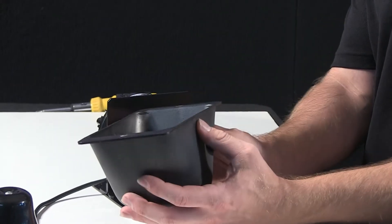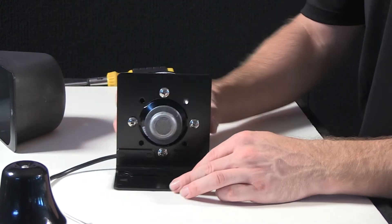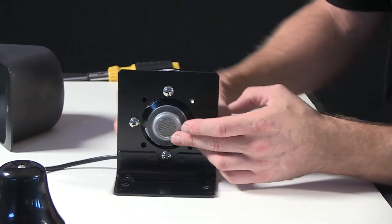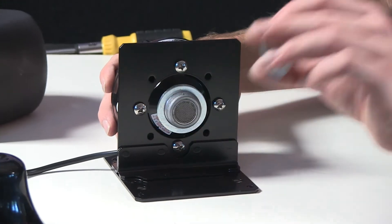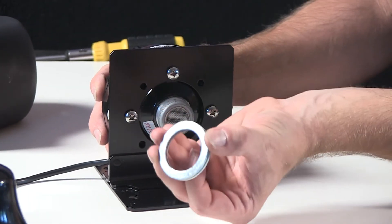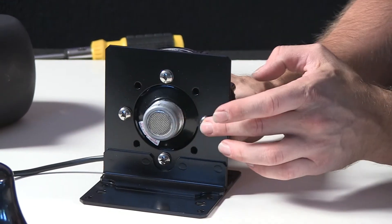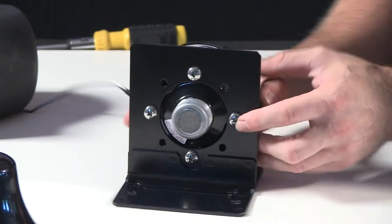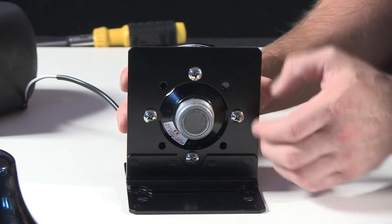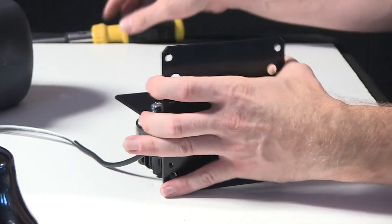The polycarbonate housing here — you can see it's a molded one-piece. On the threaded extension of the driver, you have another paper washer spacer and also two metal spacer washer rings — I'll go ahead and remove those. The driver itself, as you can see here, is held onto that cast mount bracket by four Phillips screws. I'll go ahead and remove those.